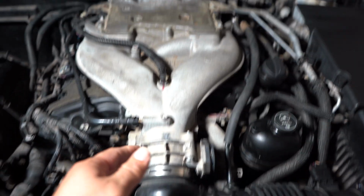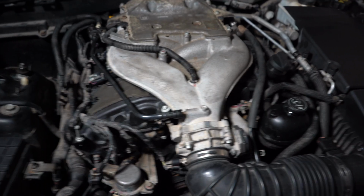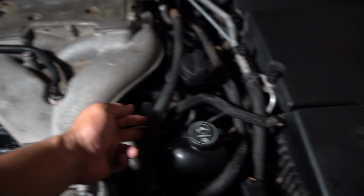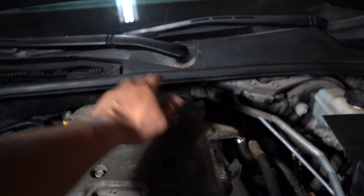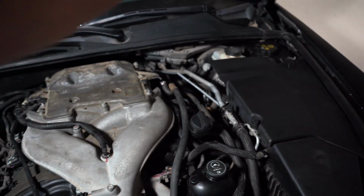Bad boy back up there. Okay, guys, looking at the engine right here, it looks complicated, but to a trained eye it's very simple. Disconnect this hose, this hose, this hose, put them to the side. These are just breathers. This thing has 6 bolts: 1, 2, 3, 4, 5, 6, one in the back. Just real quick, take them off, put this baby to the side over there.